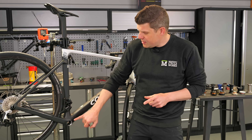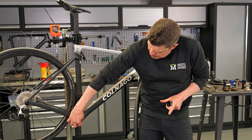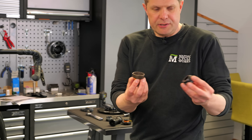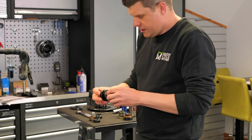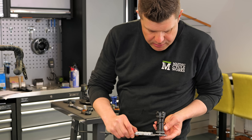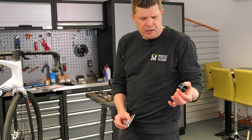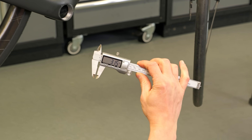My biggest concerns are: one, the paint overspray is a tricky situation, and two, we have very little material to work with. Even comparing a Shimano Dura-Ace bottom bracket to an Ultegra — the Ultegra is slightly bigger. Using the vernier calipers, you can see the Ultegra has a 40.5mm diameter and the Dura-Ace is 39mm — so a millimetre and a half less. And this is what we have to work with: 3.1 millimetres.